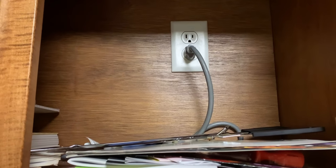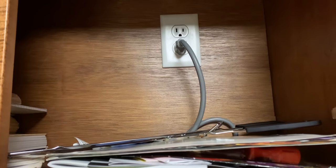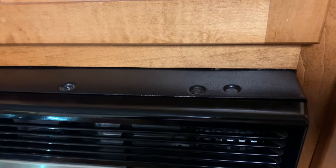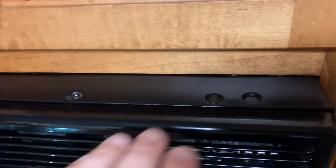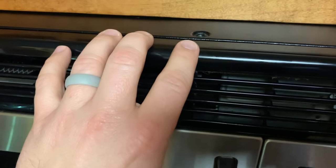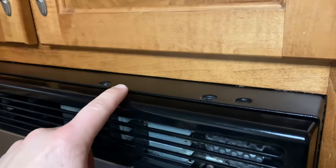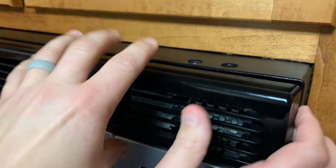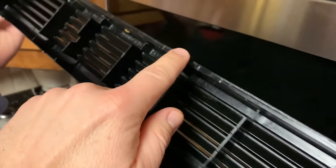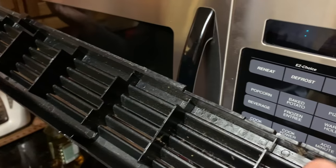While it's a less common issue, you can plug any other type of electrical device into the outlet to make sure you're still getting power there, or you could test with a multimeter if you have one handy. Once your microwave is unplugged, you have these three screws at the top that you need to remove. After those are removed, you'll be able to remove this black plastic vent cover. This piece just simply pulls down from the top and then out from the microwave, revealing these clips at the bottom. Make sure that you don't break these clips when pulling it out.